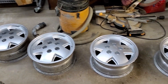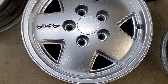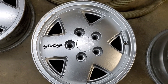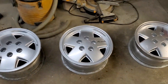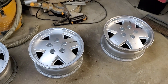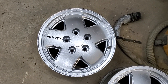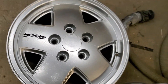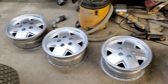We jumped a little bit forward here and we got all the wheels done. These ones are still probably a little bit wet. I don't know what's up with the clear coating — maybe I don't know how to clear coat stuff. Actually, I can tell you for absolute certain that I can't, because these came out terrible. Just a lot of orange peel type of stuff. But I still think overall they look better than the steel wheels that are on it, and I can fix the coating and painting later. Maybe I put the clear on too thick the first couple times. From a couple feet away they look pretty good.